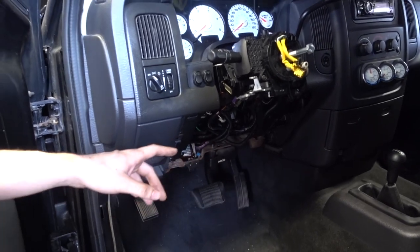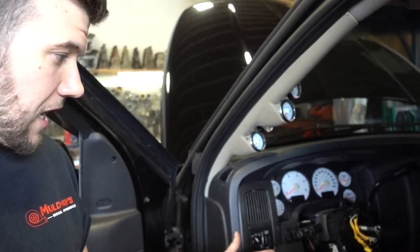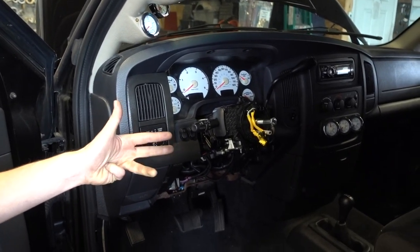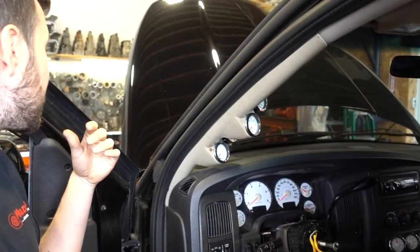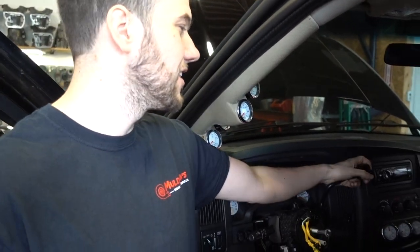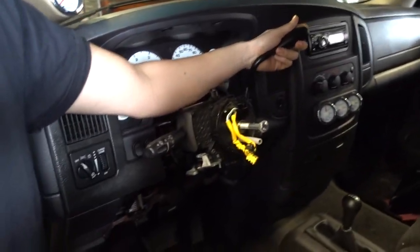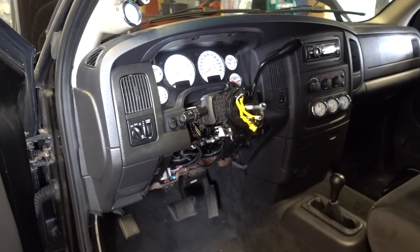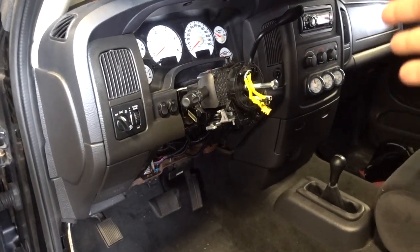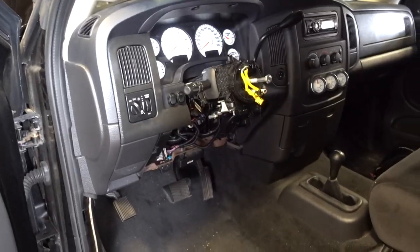So there are four things that we leave un-terminated: you've got your TPS, you've got your ignition on, you've got your CAN — which is your communication for the paddle shifters — and the overdrive cancel, which turns the paddle on, and the last is your paddle activation. We're actually going to go over the function of that when everything's done — how you flip from normal driving to paddle driving. You don't lose one or the other. It's automatic and manual. That is so cool.